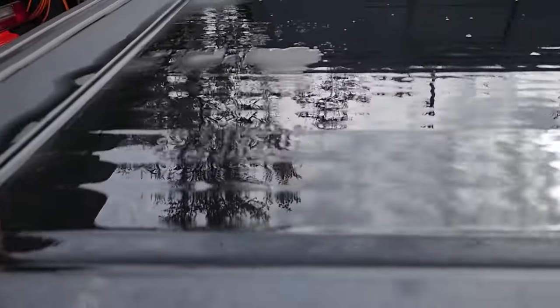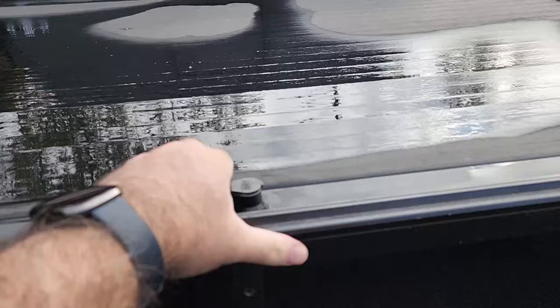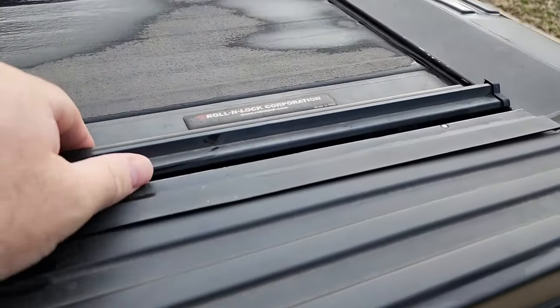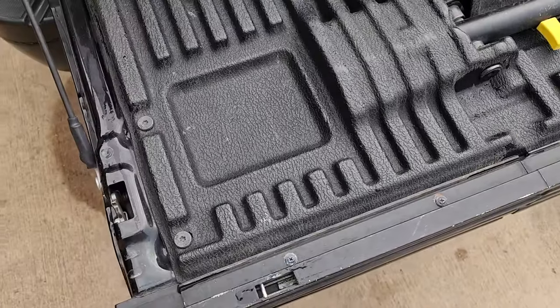Because of the vinyl cover, it drags in here so you have to lube it up more — not a huge fan of that. And now this is pretty old, but if I try and close it, it's lost its alignment and I've got a gap here where I'm getting water in. Not a huge fan of that. Now, this could easily be fixed — it just needs to be realigned — but for all these reasons, with the Retrax available to me, I'm going to go ahead and do the swap.